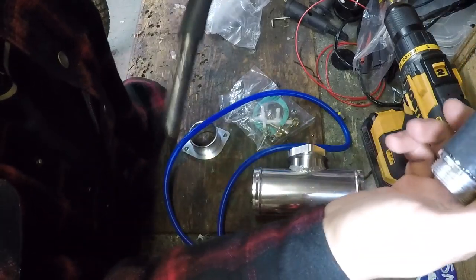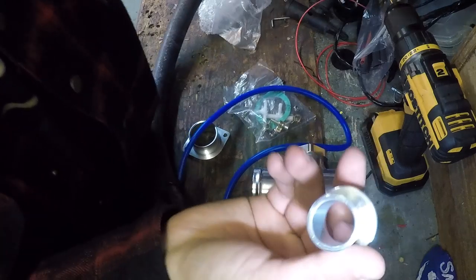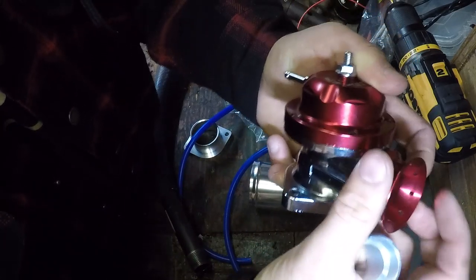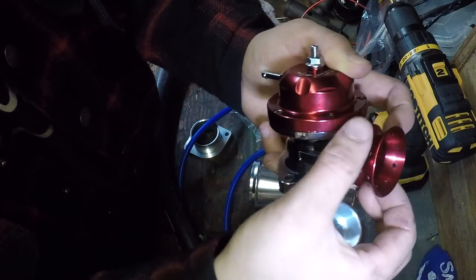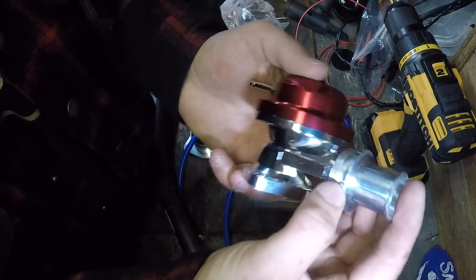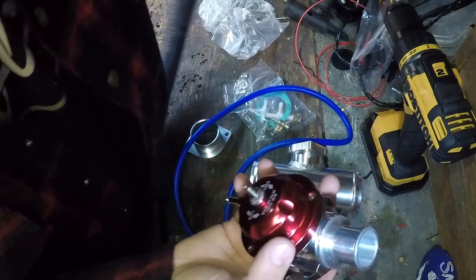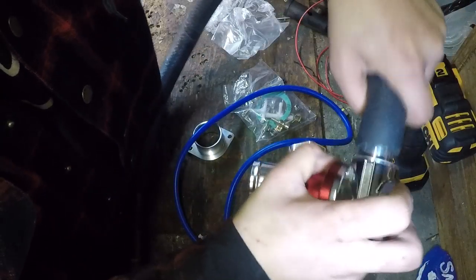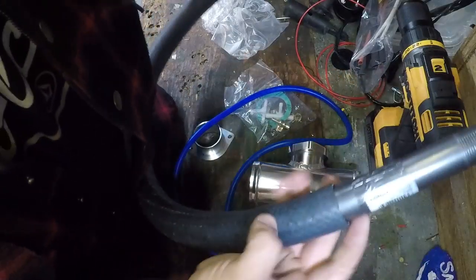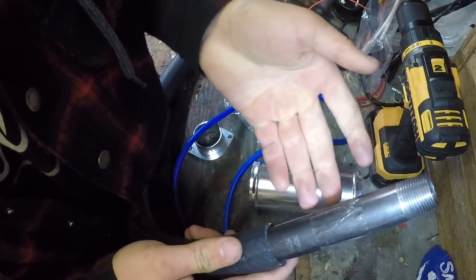We've got a nice big three-quarter inch radiator hose, and then we've got this fitting, which is really the key to the whole operation. I got this separate on eBay for like $12. What we're going to do is unscrew the blow-off-to-atmosphere fitting and install this bypass valve fitting — that screws right in there. I'll have links to both of these items on eBay. Then I'm going to use this nice big black hose that's going to go right in there, and once that air gets blown off it's going to go back into my intake manifold. This three-quarter inch black steel pipe is what I'm going to weld into my intake manifold so that air goes right back into the turbo.